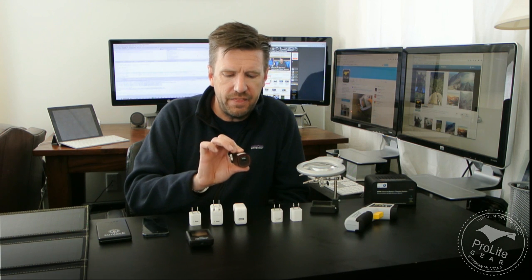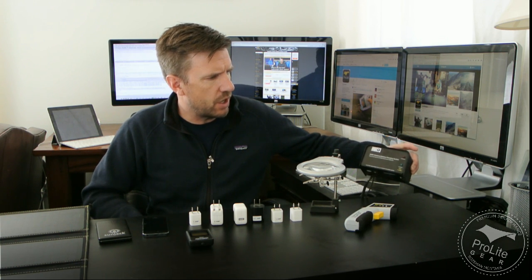Here's a device I have from Verizon — that's different from a device like this battery charger I use for recharging my BMW motorcycle. I've got another one used for recharging my automobiles. These have recharging circuitry built into them. When you look at what's going on when recharging, there's the power source, the recharging circuitry, and the battery being recharged. With iPhones and iPads, the circuitry that controls the recharging process is in the device itself. As such, the device will not allow it to draw more power or more current than it can handle, even if there's more current available. That's why when I plug a two amp device up to an iPhone, it still doesn't draw any more power than what the one amp device can send out.